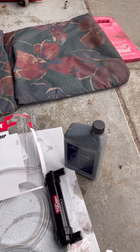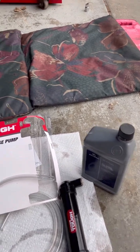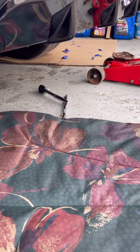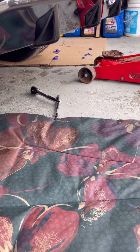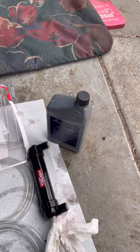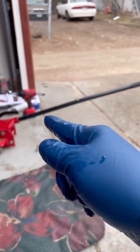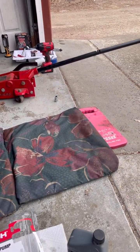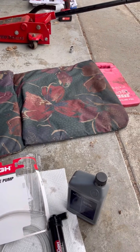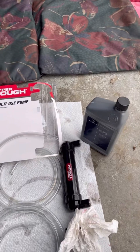That's how you change the oil on the differential — pretty easy. All you need is a 3/8 ratchet and extension. It didn't take me long at all. It was a little bit hard to get off so I had to bring out my impact tool to crack it loose. I was on the floor, so I wanted to keep it on a level surface and didn't want to put down jack stands. That's how you change the differential oil.